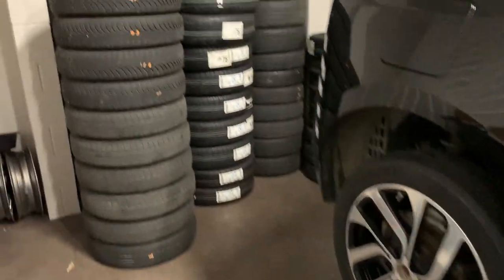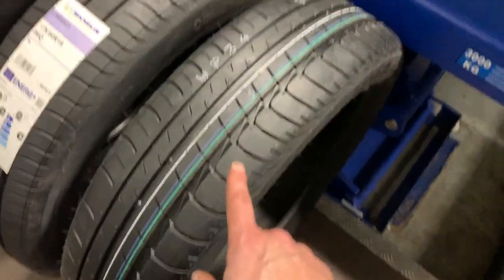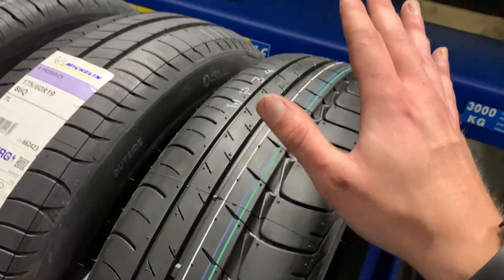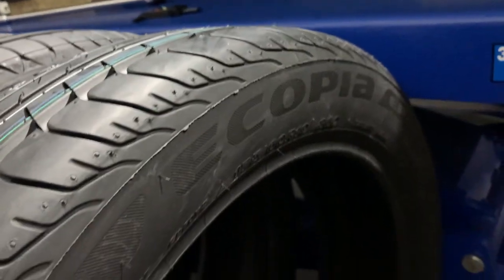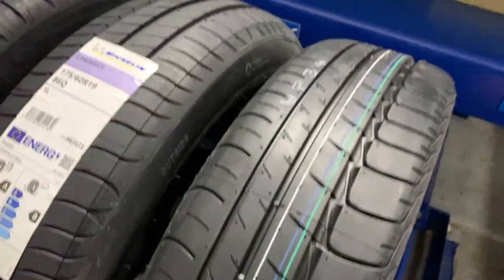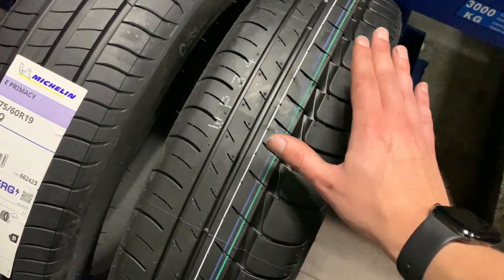Given that they're here and we obviously get through a lot of tyres, I thought why not? So first, let me introduce them. This is the Bridgestone, which for a good few years was basically the only option to BMW i3 drivers. It's available across the range — so you've got a 155 section, 175 section, and 195 section, which supports the i3s drivetrain. Within the Ecopia range, you've got the EP500, which is vastly the more popular one, and there's also an EP600, which is a really interesting all-weather tyre with a very unusual tread pattern. But I'll mention that in a future video.